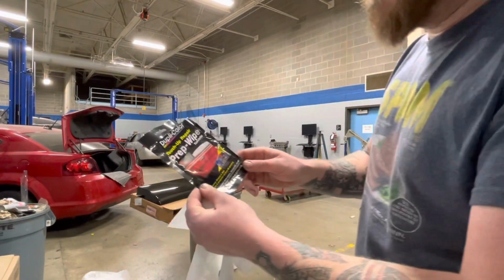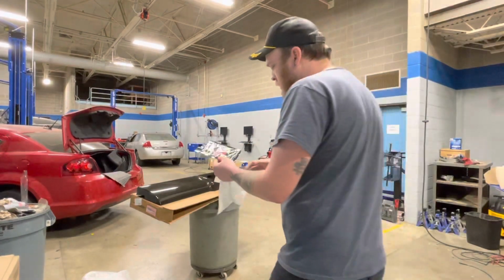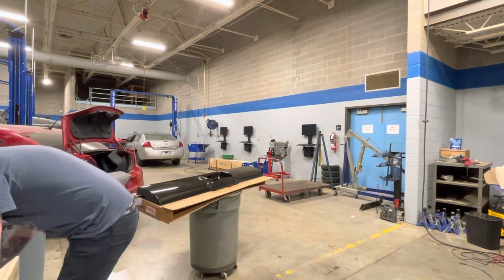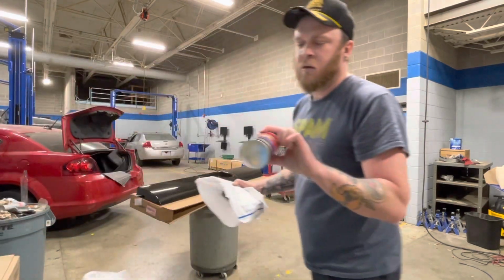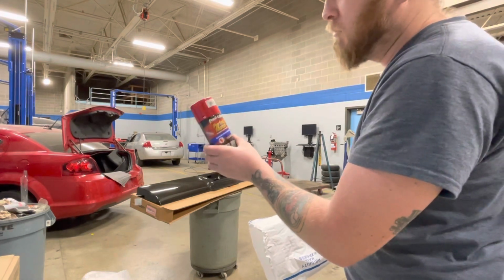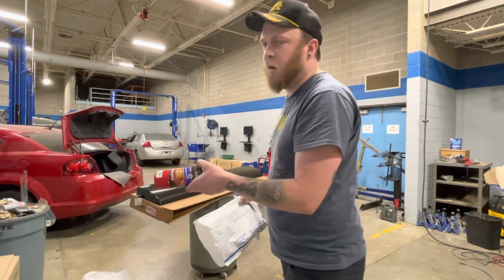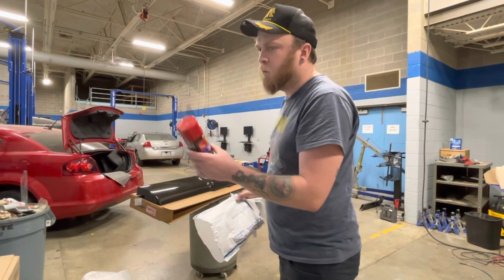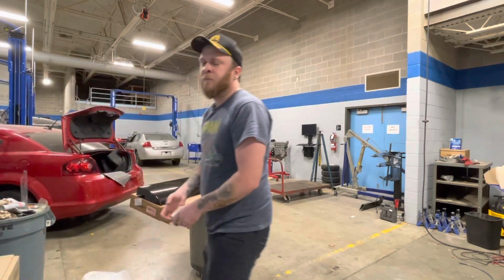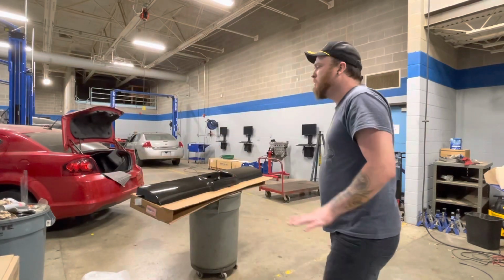Okay, so here's what I used to do the prep. Touch up, repair, prep, wipe. It came from Amazon. With a couple cans of, here's what I'm using as the base. Now technically this isn't really base, this has a hardener in it which gives it a little shine, but that's not gonna be good enough for what I want. So I'm gonna do a 2K spray can clear over it, which will give it a regular kind of automotive shine, in theory. Like I said, done this a couple times. Most of the time it works out pretty good.